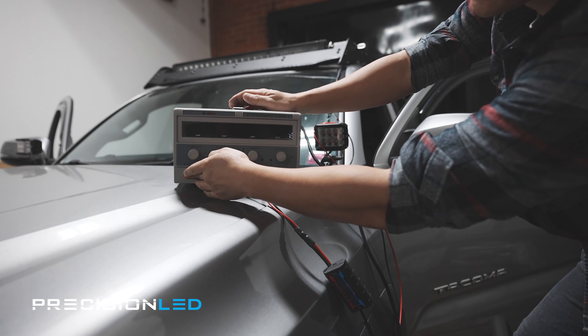Man, this is so much heavier. I should probably mention — all this extra connector work that we're doing is not totally necessary for your own installation. You could just as easily use butt connectors and just hardwire all the wires together. We just want to use the quick disconnect so that we can test between the single row, the dual row, and other LEDs we get in stock. So that's why we're using quick disconnects — you don't have to go to this length, but you could if you were cool.